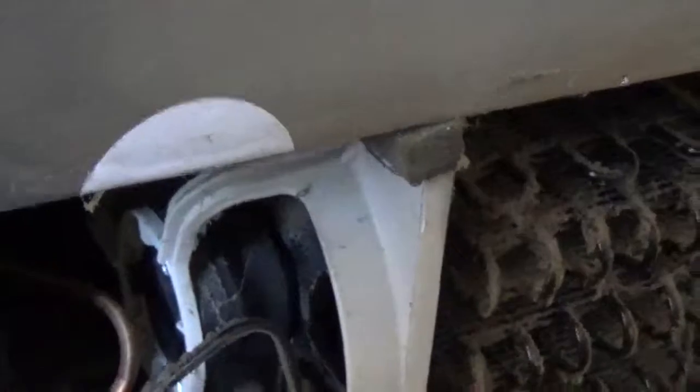So that's all we can do on that one. This one's going to need some cleaning. We use a little brush and go back in here to clean this out. On the fans, we use a little paint brush and try not to jam it in there — just try to get all the dust out that you can. Put the cover back on, and don't forget it — these run a lot better with the cardboard cover on the back. They suck air and draw it across this spot right here. You can see on the fins here — this one's dirty. It draws the air across those fins in a certain way to keep the refrigerator running cool.